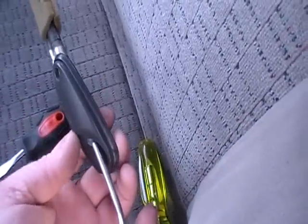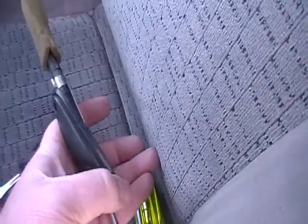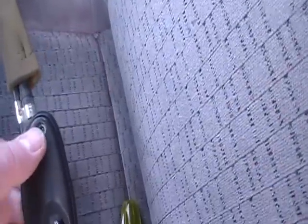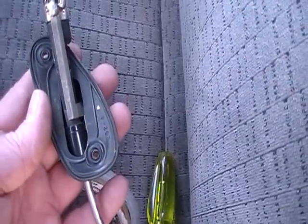First time I didn't realize that, and I just kind of meshed it on top. Now I realize there is a lip, and you just want to make sure the bottom of this gasket's all the way sealed up around that lip, and that'll give you a good tight water seal when you screw it down. Plus it'll also help line up the holes, so you can drop your screws through easier. You'll see the gasket holes line up if you do it that way.